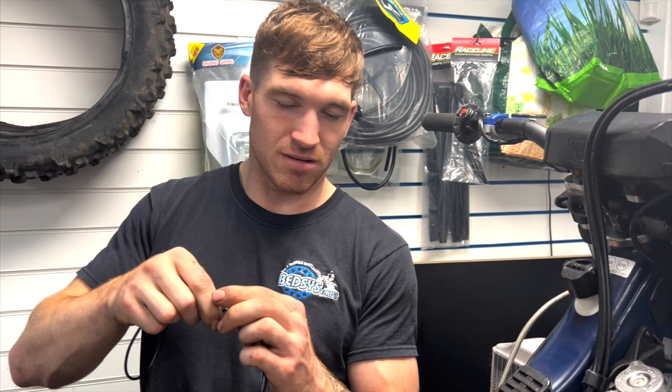What are we going to do next now, Dan? We're going to let it stop on its own and then do it again. We've tried blowing the front pipe out, haven't we? Oh, yeah. How did that go? It was a disaster. Why was it a disaster? It's got a pinhole in it so it won't pressurise up. I ain't got a welder to tap the little hole, so it's just gone on.